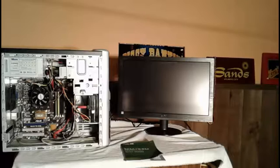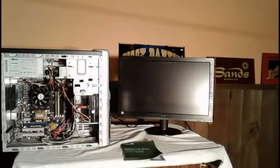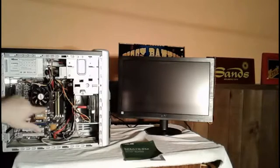Okay. Now the next diagnostic I did was I checked the monitor cable that goes to the monitor, which is right here. Monitor cable was okay. I used a replacement cable. Did not fix the problem. The second thing I did is I checked the monitor connection in the back where the motherboard is. That was fine. There were no problems back there.